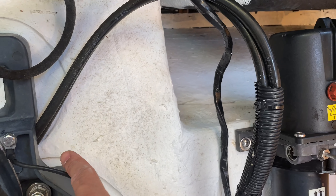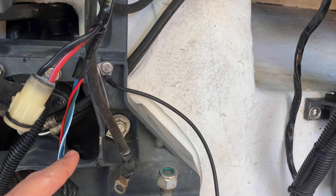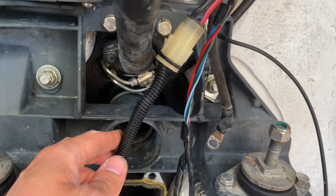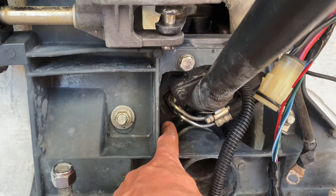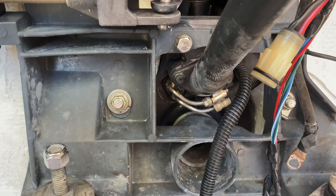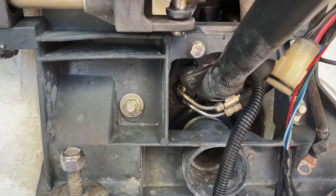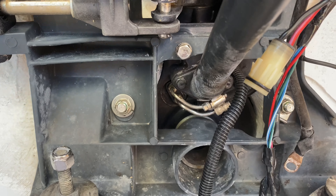Take a look — these hydraulic lines actually go behind this plate where there's a little relief cut. And as I mentioned, they go right next to this water neck. These are the 7/16 flares that actually go into the other side, and there are hydraulic lines that kind of meet up. But as I mentioned, there's not really an easy way to get to them. You've got to pull the motor out.